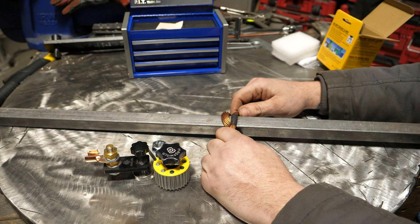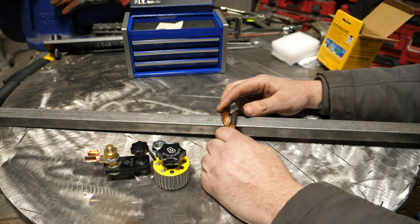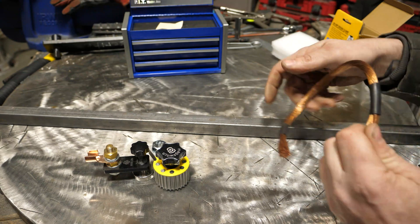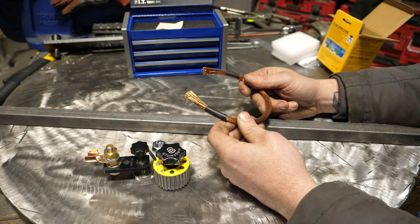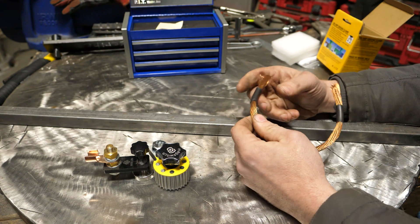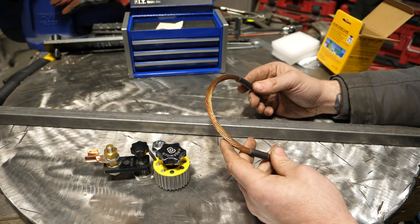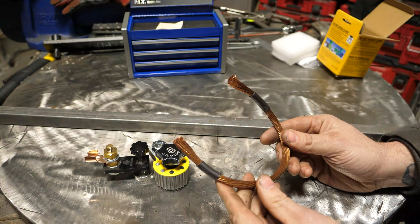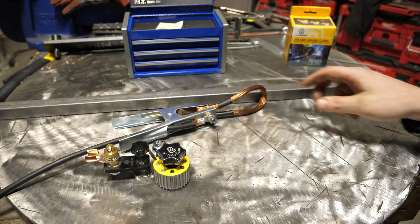It's a very handy thing to have — make one for yourself. I'd recommend using two gauge wire at a minimum, and if it's a little bigger like 1/0 or 2/0, even better. Keep in mind that over time bare copper will oxidize, so if you keep this in your toolbox and it starts looking filthy, take some emery cloth and rub it down to clean the surface oxide off so you always have a good ground. Very cheap, very effective, and very useful.